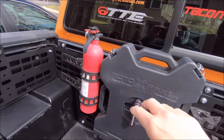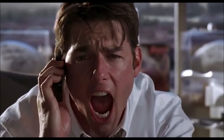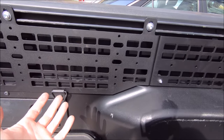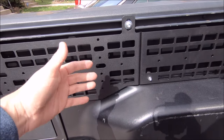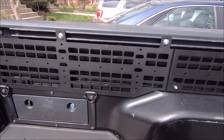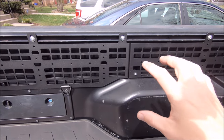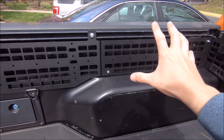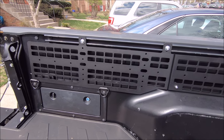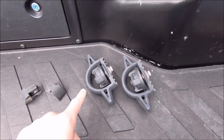And of course, plenty of clearance if you do plan on getting the rear Cali-Raised MOLLE panel, which I highly recommend. Now, usually when installing MOLLE panels like this, I always recommend, if you know what you're going to mount and where, go ahead and do that beforehand — it's much easier while you have access to the rear of the panel before you get everything bolted down. But since this one is literally just five bolts holding it on, I'm not too worried about it. I can add some quick fists on there in no time. I've got a water port I want to try to mount on here — something I'm not going to keep on the truck all the time since it's sort of hard to secure to keep it from getting stolen. And I'm going to see if I can get my axe and shovel mounted on here since I am not currently running the bed rack. Just don't forget to install the end caps on the bed rail and your two OEM cleats.